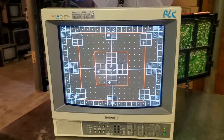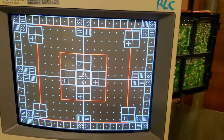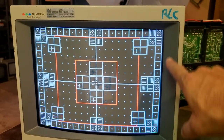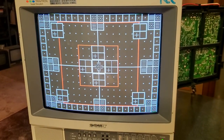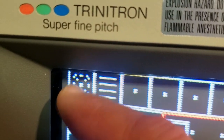Let's check out the 240p test suite. This is the monoscope pattern — it's in good shape and looks pretty nice as-is. You can tell the yoke is not leaning; it's pretty well centered along the top and bottom. There is some screen bowing where the screen bows towards this direction on both edges — it's difficult to see on camera but visible if you look closely. Getting in close for a convergence check, you can see in this corner how the blue is slightly separated out from the green and red, causing a blue shadow or hue beyond the white line.